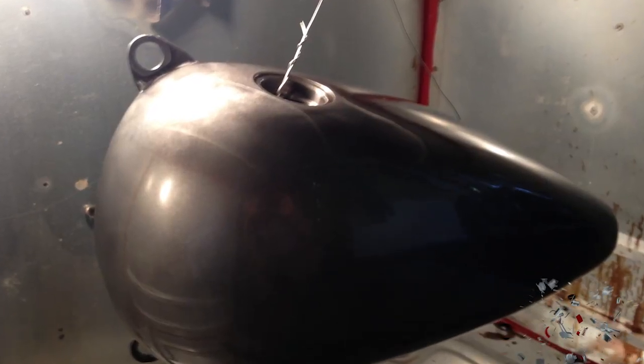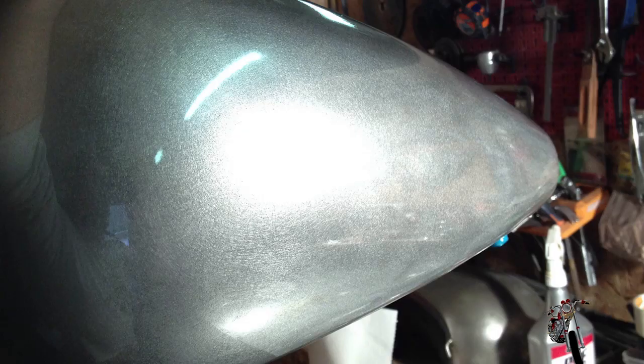So, I took another set of tanks and after sanding it down to metal, I gave it a nice coat of clear powder. The shiny metal look will replace the silver leaf look I had in mind. It's quite different, but still a very nice alternative. Another advantage of using a powder-based coat for the tank is that it will make the sheet metal 100% rust-proof, where regular airbrush clear coats, at least the type sold here in Europe, will not keep the metal from rusting. This might be useful to some of the folks in California where environmental regulations are just as strict.